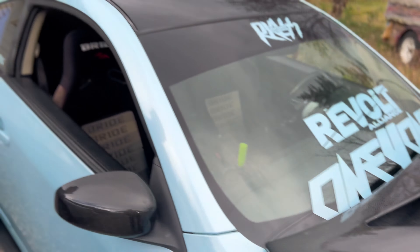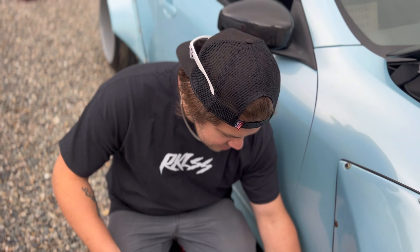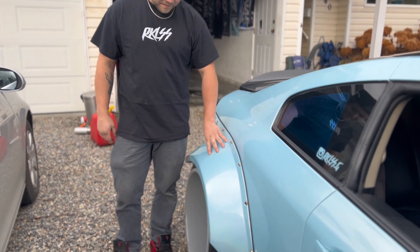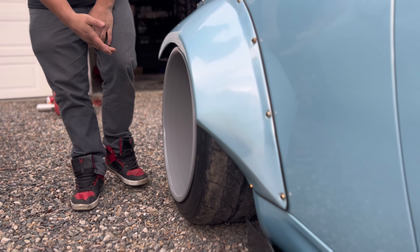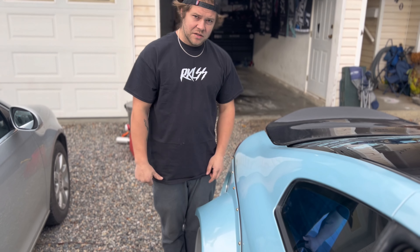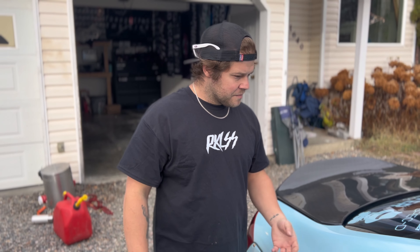We've got their side splitters on it right now, but the biggest issue is they're not as wide as the car, so we might be going to a custom side splitter to keep the width. The rear flare is Fiberglass Mafia too, but when we bought the wheels we went to a size nobody's ever done on the G35 before — 19x15 rears with a 345 Nitto stretched onto it. They didn't fit at first — we were rubbing and almost blew a set of tires. So we had the fender cut in half and widened another two and a half inches on each side to tuck these wheels. I really like how the rear being wider than the front gives it nice thick hips.